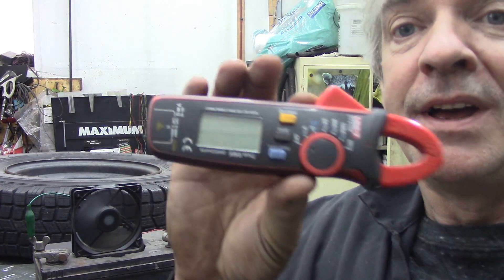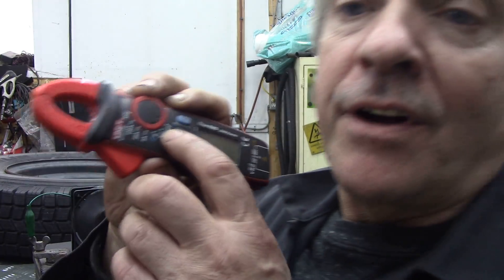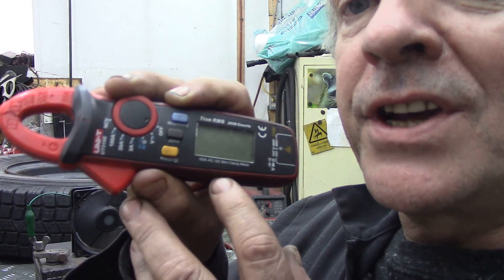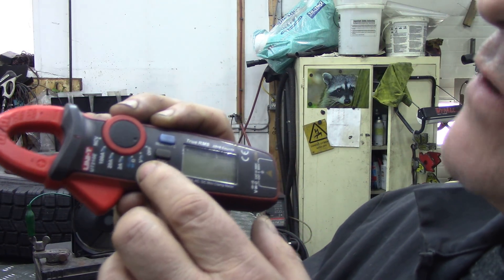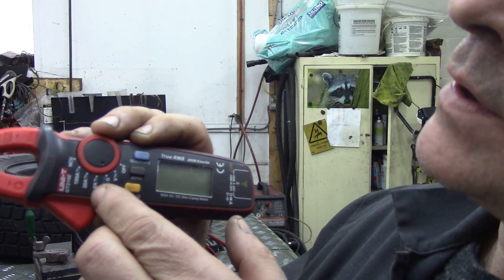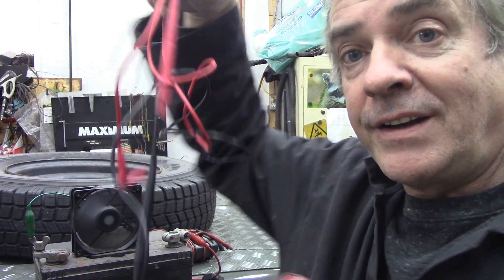You're wondering why I've got this little fan on here — this is going to be a demonstration to show you how we use this and how we set it up. I'm going to get it the right way around. The instructions in it are pretty vague, so I thought I'd give you a rundown because if you do buy one you'll be stuck. It's got a little thumb wheel here where we can change the settings. The settings are very straightforward: we've got off, volts, ohms, and then we go on to amps — and this is the section that we're doing. The volts and ohms are used with the assistance of cables that are provided.